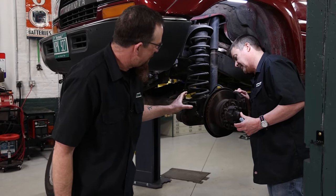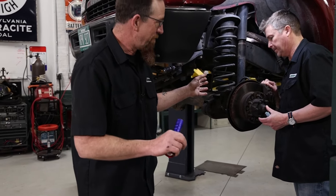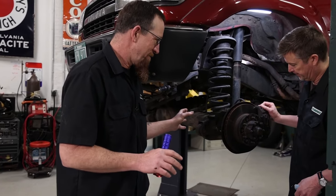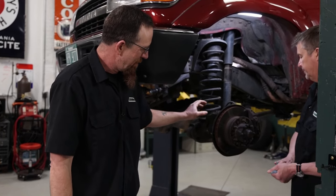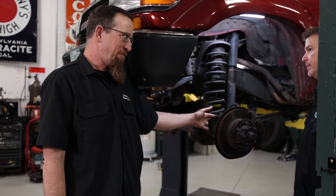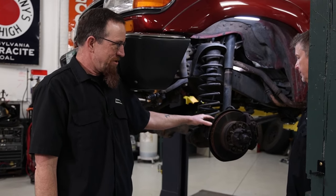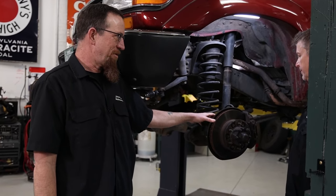And with almost 200,000 miles on this, because it is also all-wheel drive, part-time, full-time, whatever you want to call it, the axles in here, which are a CV joint called a Birfield by Toyota, get very worn out and start clicking and making a racket, which these ones are. So we need to replace the Birfields.